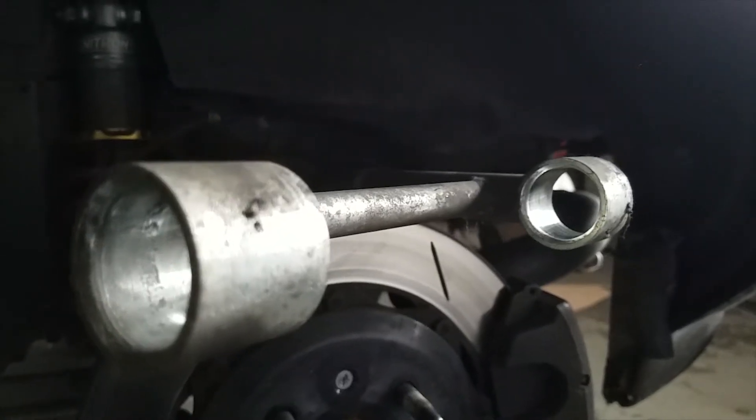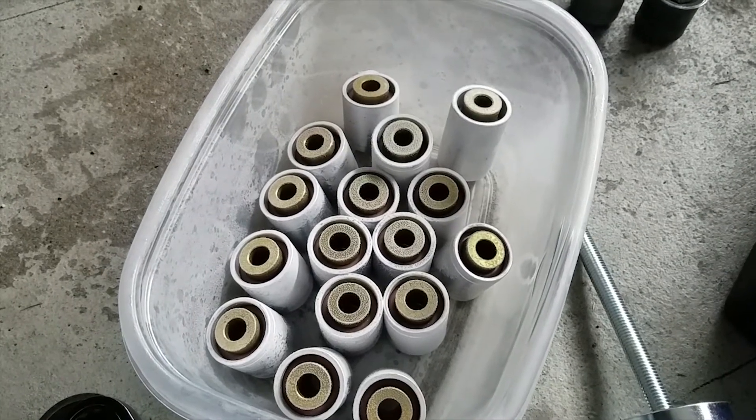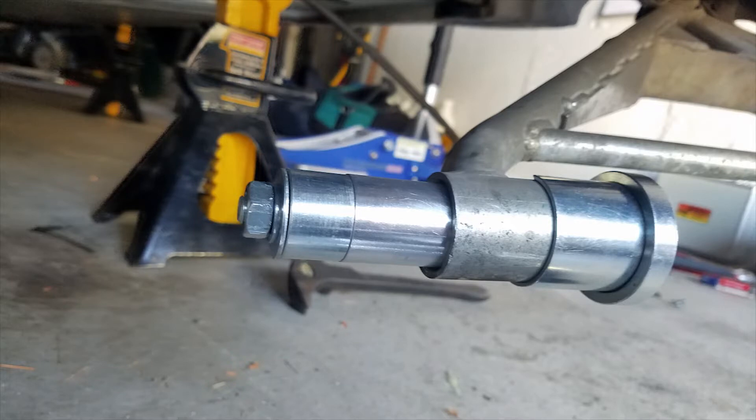The A-arm now has both bushings out, and I've wiped the inside of the bushing area with a microfiber cloth — it's pretty clean in there. Here are the monoball solid bushings that will replace them. They've been in the freezer all night so they can be as small as possible and fit in more easily. The original tool came with an 8.8 grade bolt, which is insufficient to push in this type of monoball — it's a pretty heavy interference fit, and the 8.8 bolt stretched and bent slightly.